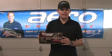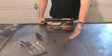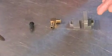Welcome to the world of Parley's Diesel Performance. Today we'll be installing an adjustable fuel plate on a 1998 Cummins 12 valve extended cab. We suggest before you begin laying out all of the parts. As you can see, the adjustable fuel plate — today we'll be installing this in the maximum forward position to achieve an additional 125 horsepower.